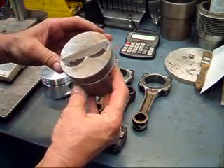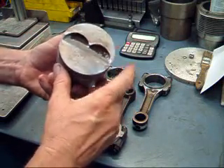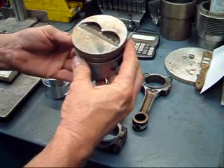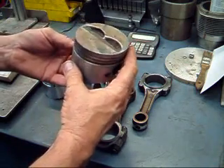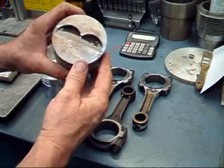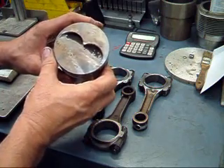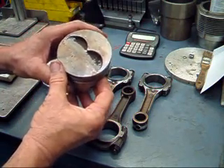This is a stock piston — it came out of the X19. As you can see, it has some fairly large valve reliefs. This is for what we call a free running engine, so if the cam belt breaks, the valves can stay open and the piston can still go up and down and not hit anything. Kind of a nice feature, but not optimum for performance. The problem we have with this style of piston is we have unburned hydrocarbons that wind up in these little pockets, and we want to try and eliminate that because we want everything to burn that's inside the combustion chamber.